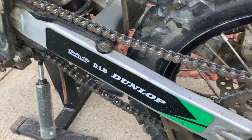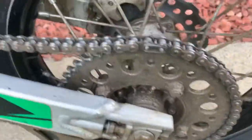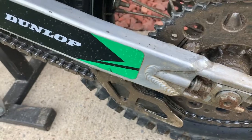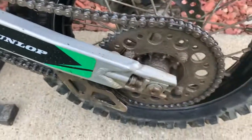That's how you do it on a KX85 — easy as hell. Get it up off the ground; we have it on a stand so the wheel is free. A three-quarter inch loosens your big axle nut, you need a 12mm to hold it and a 10mm to tighten it. Very easy, do it yourself, lube it up, and get ripping. Alright, over and out.